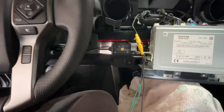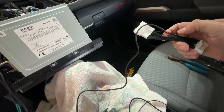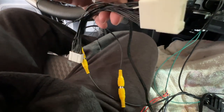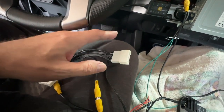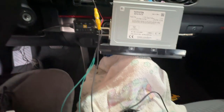I went ahead and pulled the wire back through because I just didn't want to mess with getting all that spaghetti wire up behind the dash — I'm going to run the wire down and back out of the front. Got all the wiring run; it's all back into the cab. Now we need to disconnect the gray plug and the white plug. The gray plug goes into the harness with the red wiring on it, just for identification. The white plug goes into the harness with the RCAs on it — it also has a white wire right at the edge. You can't plug them into the wrong ones; they won't fit.